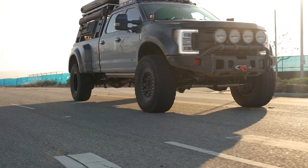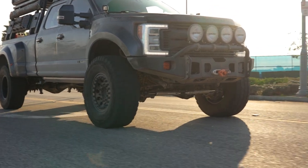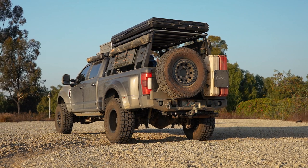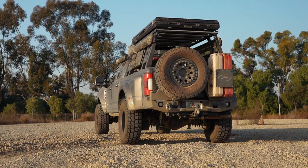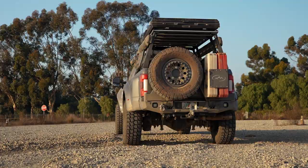This truck is going to have the front and rear custom-tuned King 2.5 shocks and Carli soft ride front coils. In the rear, due to the weight requirements with the bed rack, the huge bumper, and the spare tire, it actually is sitting on the HD leaf springs — a heavier duty leaf pack designed for 1,000 pounds of full-time bed load.